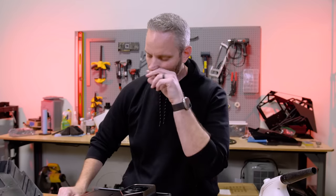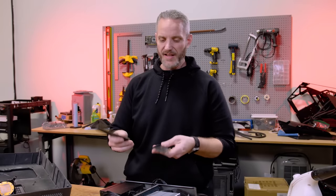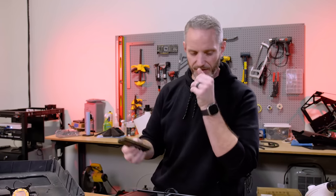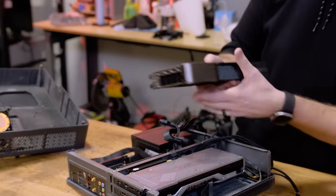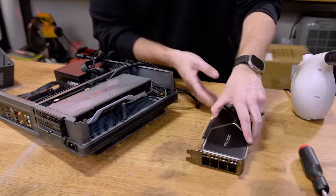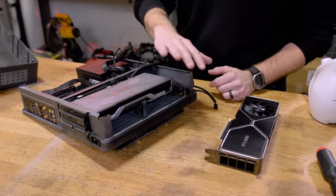You're going from a 9900K, so you're going from two 8GB sticks of DDR4 3200 to at least 32GB of DDR5, which will be like 5000 megahertz or faster. With how much you're playing Elite and stuff with Phil now, we need to have you not stuttering as you pop into these star systems. You're now going to have flow through directly into your rad. These fans are blowing in on the graphics card, but this graphics card — all the air has to exhaust around the outside of it. The 20-series Founders cards had terrible airflow.